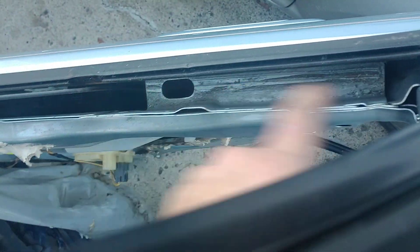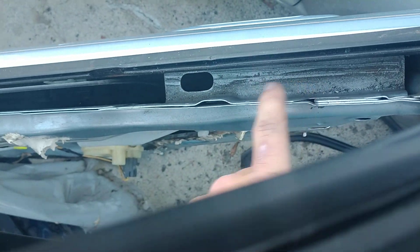Once it's out, if there's any glass — and usually there's going to be glass if you're doing this replacement — you need to clean this entire tray area out. I just had to wipe mine out because I don't have a vacuum handy, but after everything's back together before the door panel, I am going to have to vacuum out the bottom of the door to avoid the shaky noise of glass all the time.